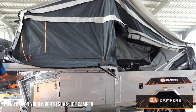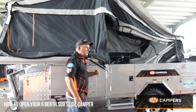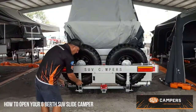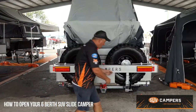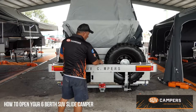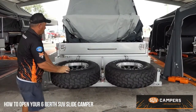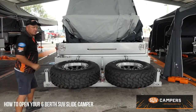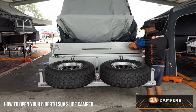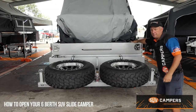Locking your winch into place. On a grand it does have a side center locking device if you want to put that on. Then it's a matter of walking around to the back of the camper trailer. On the rear there are two safety locking pins that have just come out — one on each tire. Then there's an over-center latch that you undo and the tires simply fold down. Undo your T-handles on the back of your draw slide and then your drawer simply pulls out.